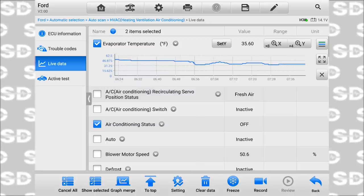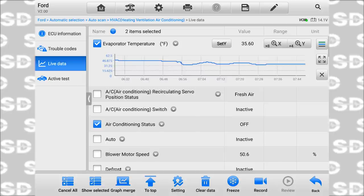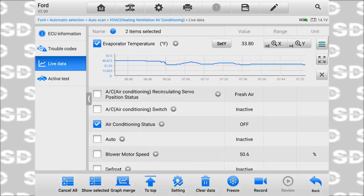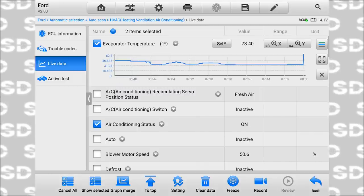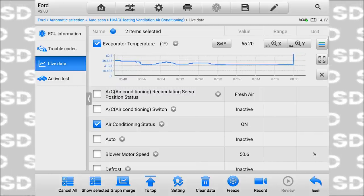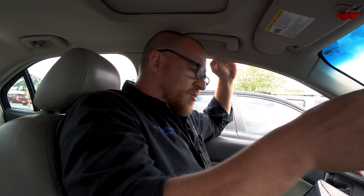Stupid graph. All right, 35 degrees. Evap would be in a normal state right now. You would shut the AC off because 35 is cold, and you see the off status. Now we're at 33.8. We don't go from 35 to 33 with the AC off. That doesn't happen. Bam, just went to 73. AC turned back on. That shouldn't happen either. This still could be a faulty climate control panel because that's what controls the evap temp